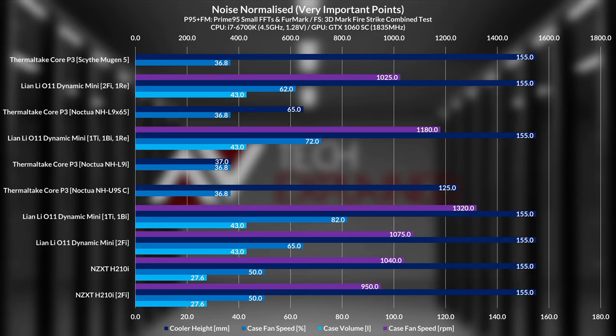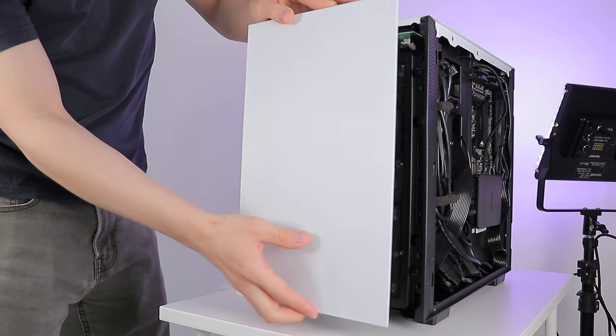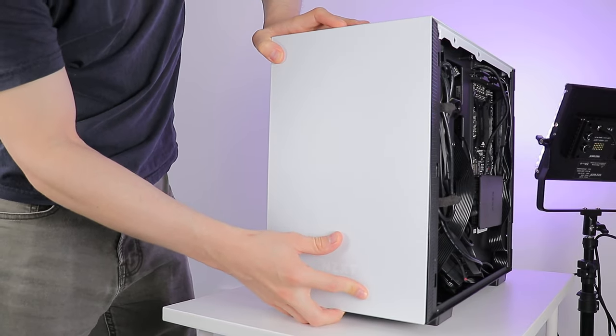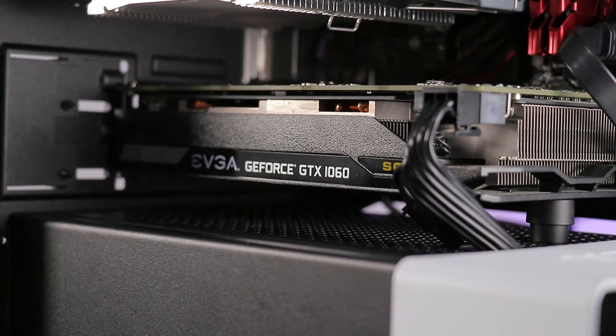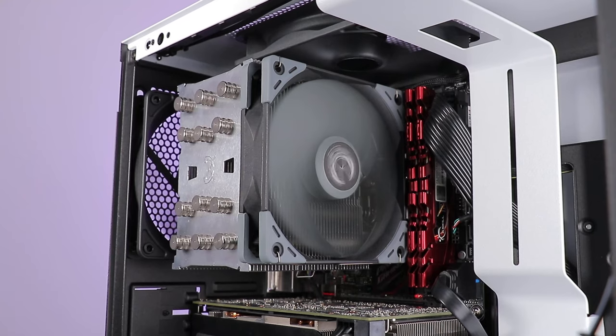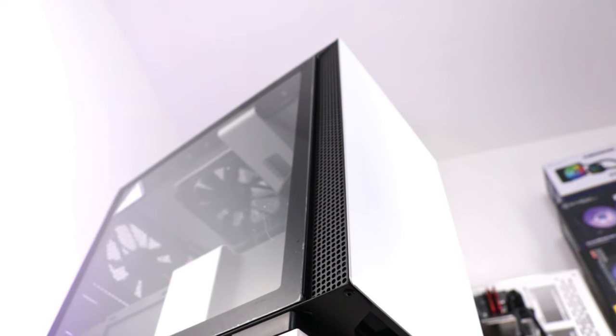Very important points for this testing: the H210i fans were spinning at 50% speed, and that didn't need to change when adding the extra fans. The Noctua NF-F12s were quiet enough to not add to the noise output running alongside the stock fans. So overall, the H210i is good for CPU performance and not great — actually pretty bad — for graphics card performance. It would appear that the panelwork around the graphics card could do with some attention, though I'm quite pleasantly surprised by the CPU thermals throughout the testing, given the meager-looking intake area around the front side intake.